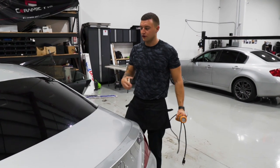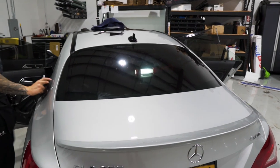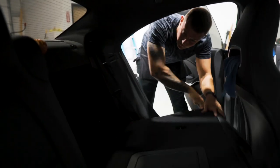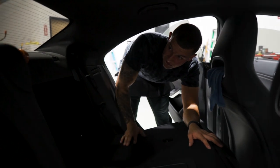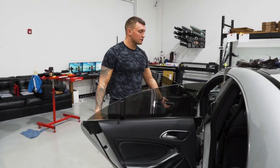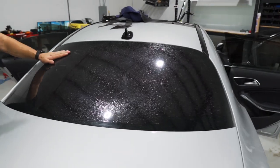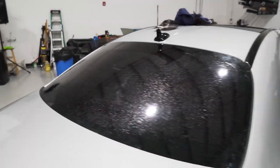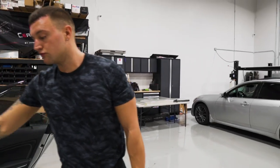The window is all shrunk. We're going to use a drop light on the inside so we can see the line to follow, and cut it out. Installing this piece of film is very tight in here. One way is to put the seats down and fit in the back seat — that's probably how I'm going to do it because I know I'm not fitting with the headrests in the way and they're not detachable. We're going to do the Frankenstein method off the back. Use whatever method you've learned — the Frankenstein method off the back window, off the door, or the reverse roll method — whatever is most convenient for you.